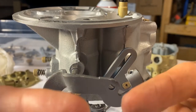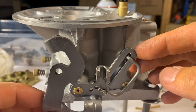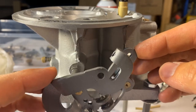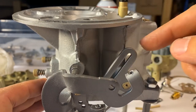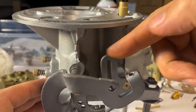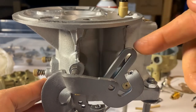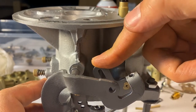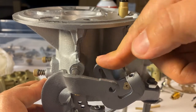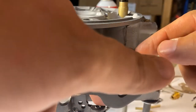The foreground is the driver's side of the car or vehicle. With the primaries wide open, we test to make sure that we can have no binding on the secondary — and you can hear the vacuum action there. We'll double check with the visual up top. Those are wide open there, and no binding anywhere. We're doing nice and really good.